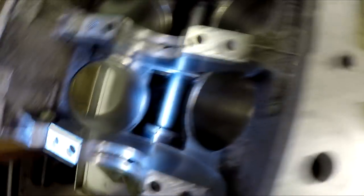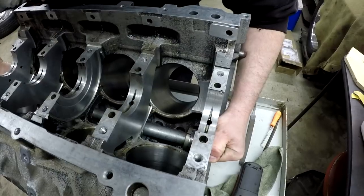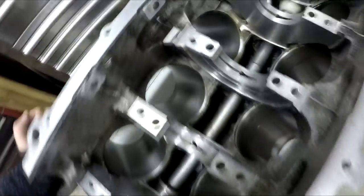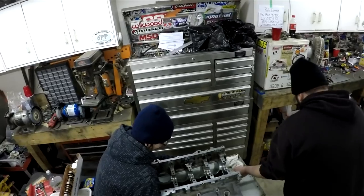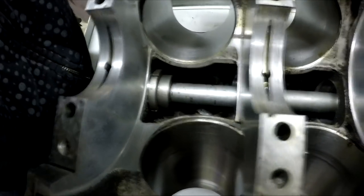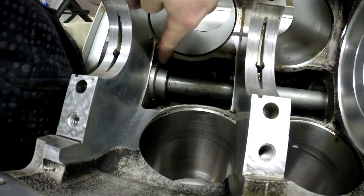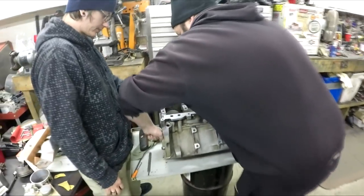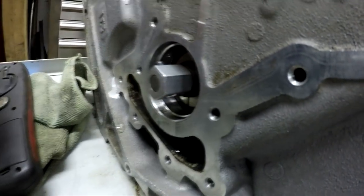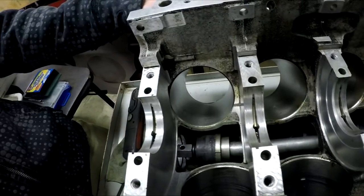The block is moving a little bit. It doesn't look completely square. It's straightening out a bit though — it's going in nicer now. It's going in until the tool is all the way through. You can see the old line. A little bit more... she's in there. While doing this process, you do have to take the tool in and out in tricky ways.